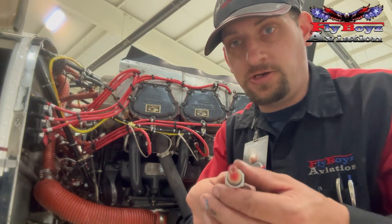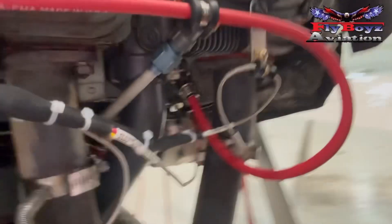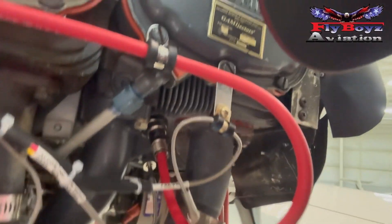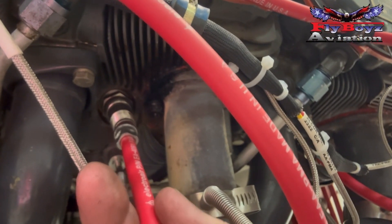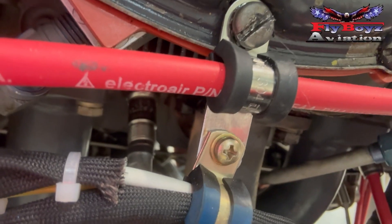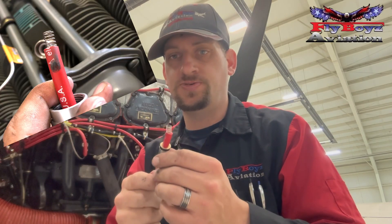When you pull your nut down, you should have proper engagement into the spark plug. If you can see right there, this is actually a little too much. Now that we've got this formed, as we do a fit check — as we put this into the plug, we've got a little bit of resistance where it makes contact. We want just a little bit of resistance as it goes into the spark plug. When you've got the nut screwed down with positive resistance, it's not causing it to arc between the lead and the plug, because that will damage the plug and the lead. That'll be evident by black marks and arcing either along the end here or along the end of your spring, and you can also see it inside your spark plug.